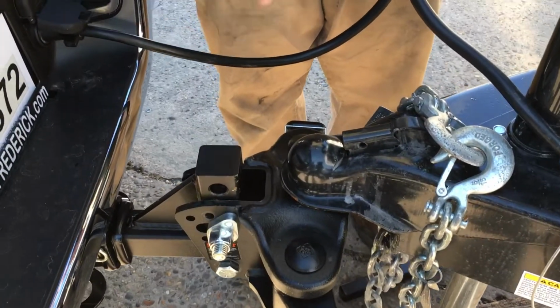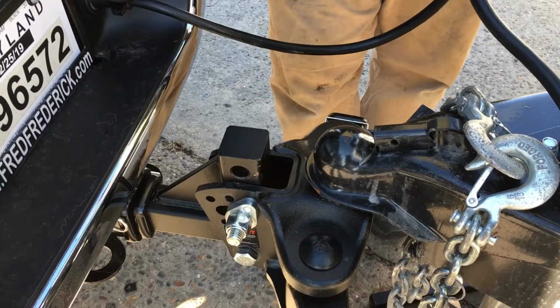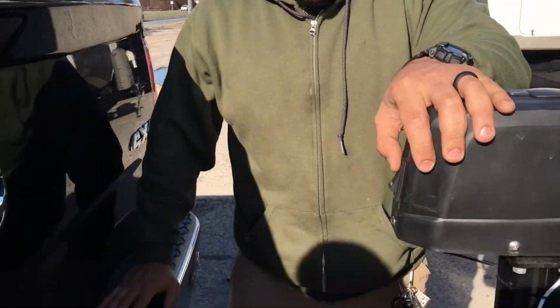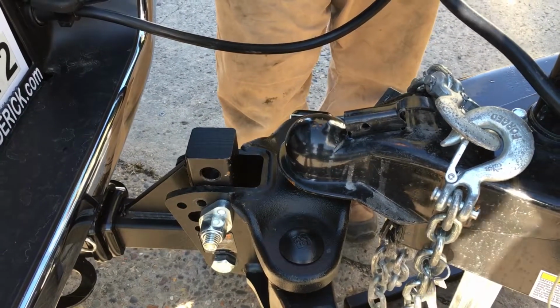At this point, with the hitch, once you've locked it, you're going to press up on the jack. Up. And then you install the bars. What happens is the bar right now is like this. As you raise it up, the bars come closer to the bracket. Then you can put your bars on and bring it back down to level. That's the part I know I'm going to forget. Trust me, once you've done it one time, you're doing the same process but backwards when detaching.